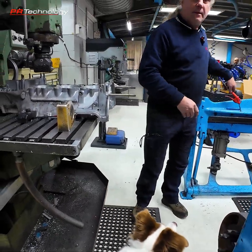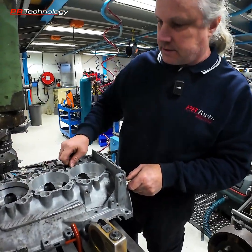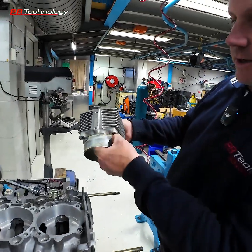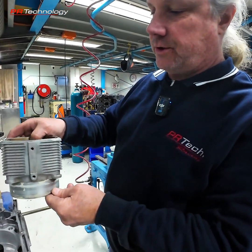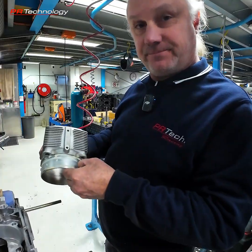Okay, so that's where we've ended up — we've got a groove inside the crankcase for the quad ring, which will seal against the barrel on the outside. This is an old secondhand barrel I'm just using for measurement. The case can now be assembled with the new upgraded 3.8 litre kit — no oil leaks, job done.